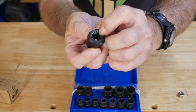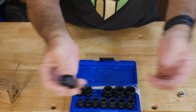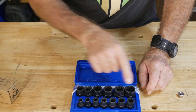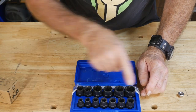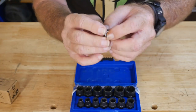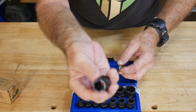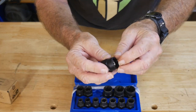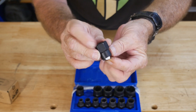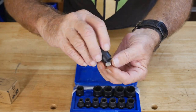Or you can use your three-eighths socket ratcheting set, whatever, and get on top — that way you can drive down on the nut. Especially around motorcycles, cars, trucks, whatever. God knows we all have rusted nuts at times. It goes from quarter inch to three-quarter inch in size, and it also has the metric — something like 8 millimeter to 18 millimeter in nut. I just grabbed a nut out of the drawer here to give you an idea. A lot of times the sockets will just get rusted, they break down, and all of a sudden the socket kind of rounds it off a little bit, and the nut becomes kind of useless. So what I've always done with a kit like this — I keep actually several of these kits around — is get the right size first. Put this down on the nut, and if I'm really having a bad day, I'll take the hammer and bash this thing down a little bit to get the teeth to really bite into the nut first. And then I'll turn the nut off to remove it.